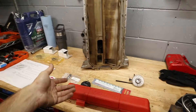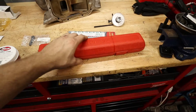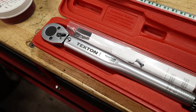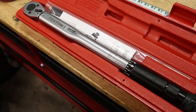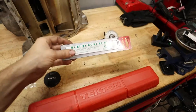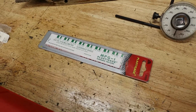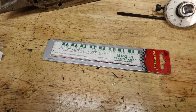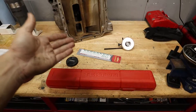If you go with ARP bolts, for example, you wouldn't need the angle gauge — you would just need a torque wrench, and that's what we have right here. This one is made by Tekton; I'll put a link below. This is the three-eighths version, which should work well for this job since we need to go from 5 newton meters to 30 newton meters. Then right here we have some plasti gauge. This is what engine builders use to check clearances — it's not exact, but it gives you a ballpark estimate to confirm your rod bearings are the right size.